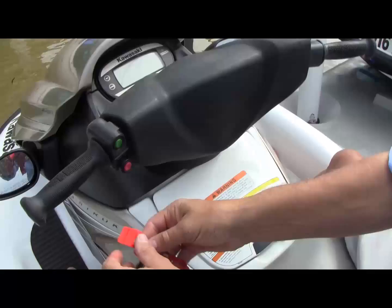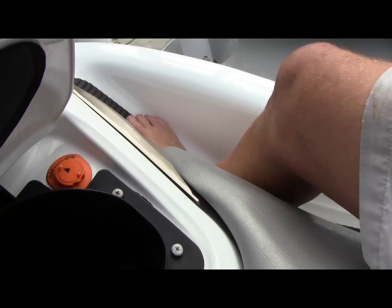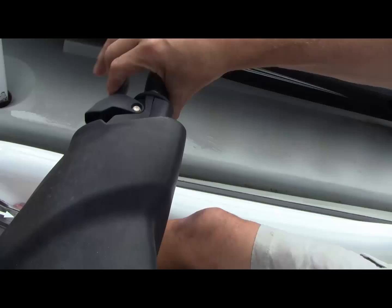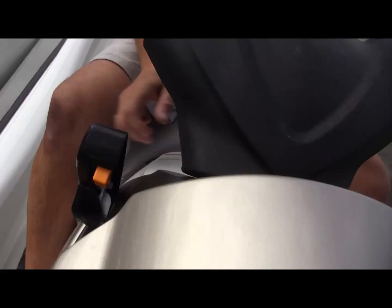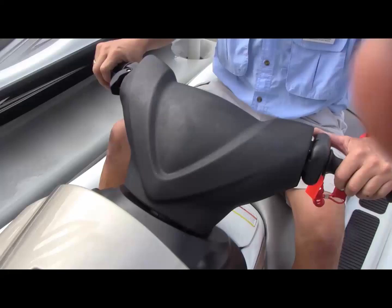For your safety, we also have a compartment that opens up where you can slide in certain things — glasses, and so forth. There's the on/off switch, folks — you are not to touch that at any time while you're operating the watercraft. What you want to do is use the stop and go buttons on the jet ski, and then use your throttle cable, which is located on the right portion of the handlebar, for forward and reverse as well. We have a forward and reverse lever — that reverse lever bar pulls up. You simply squeeze the bar and pull it up and down. Folks, you never want to use the reverse lever unless you're at idle. Throwing that reverse lever at full speed will cause you to flip the jet ski and throw you off, causing bodily injury.